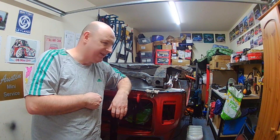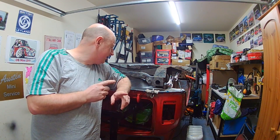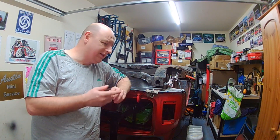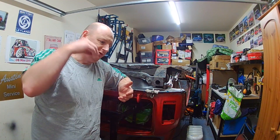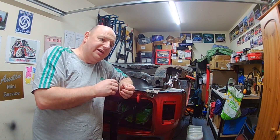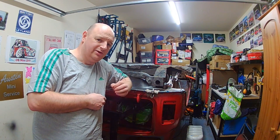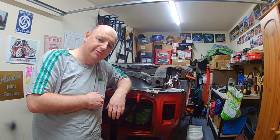If you're getting frustrated with it — which you will — just walk away and leave it and come back another day. I had to do that a few times before I've done this. I'll give you a look around and show you what I'm up to at this stage. Then I can get the car spun round because I'll need to put some self-tapping screws in again to pull it closer with the panels on the inside, and then a couple of plug welds and work from there.